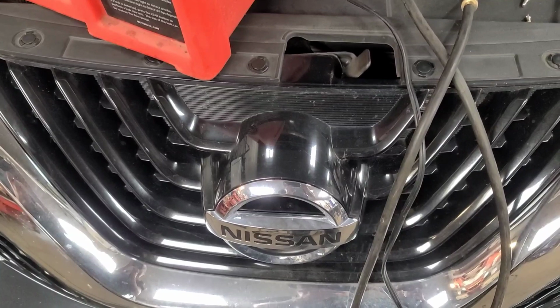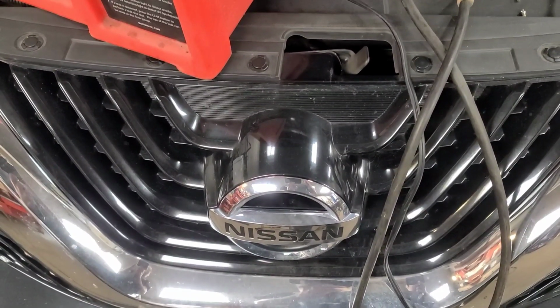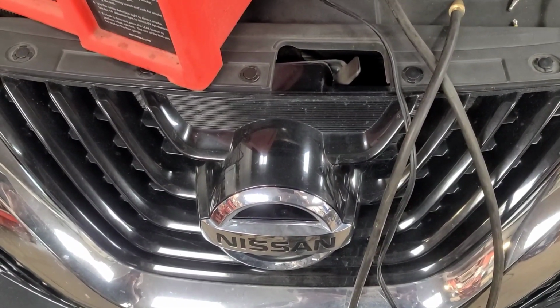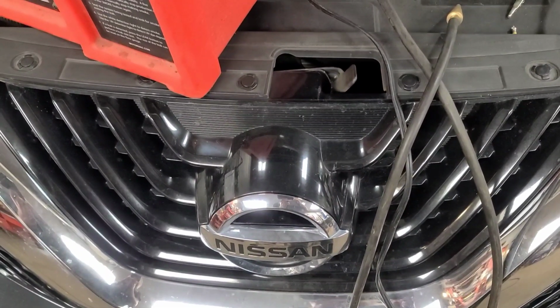Well, good day, viewers. We're back working on this 2015 Nissan Murano. I did a previous video on it. I'll put a link in the description. One of the problems it had was a P0456, which is a small leak detected in the evap system.